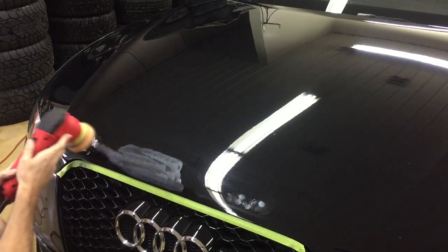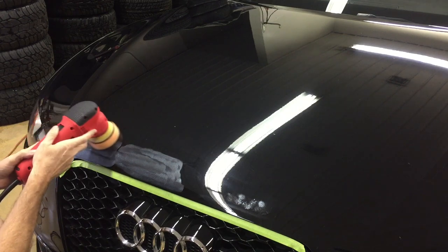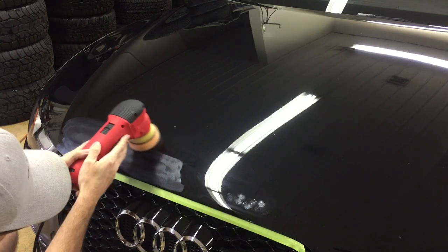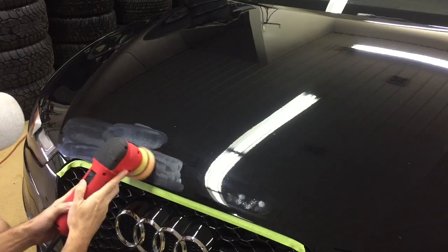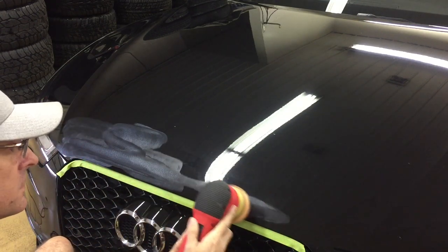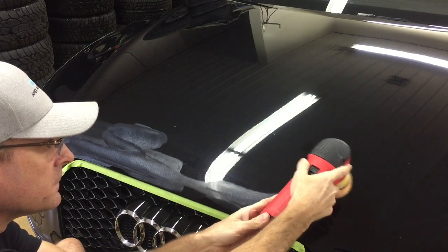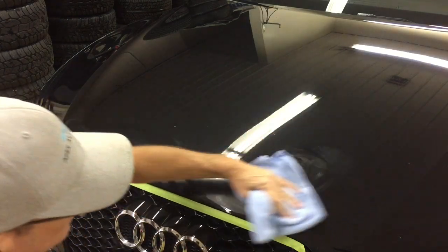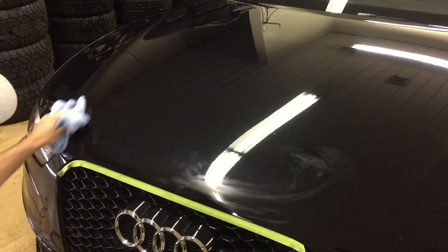You want to keep the polishing pad well enough away from the edge. You don't want to get any cutting cream in the corner, nor do you want to lift the edge with your polishing pad. I have a nice plush microfiber within arm's reach, so we're going to get the residue off. Hopefully this will be good enough and we can jump to the next step.